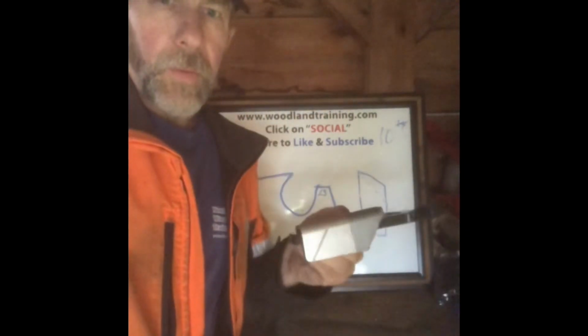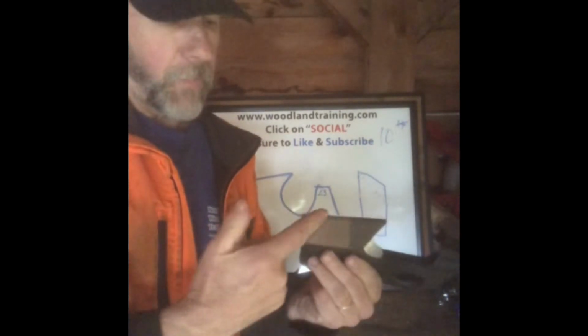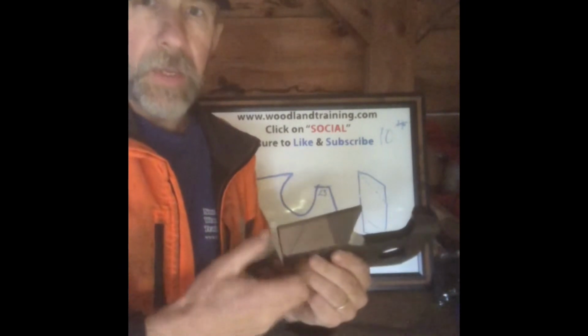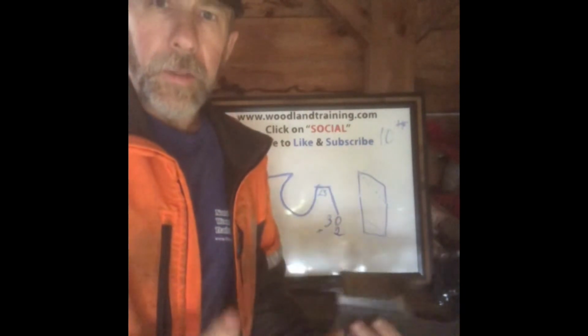Now think about it, that part of the tooth is never really used, right? We never file back beyond that witness mark. I mean, if you do, you're really milking every bit of life out of the tooth. You know, typically you get about to that witness mark and your chain is shot.